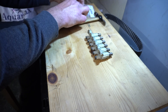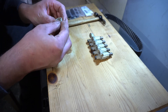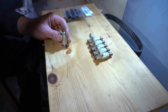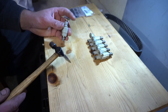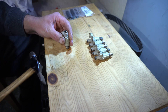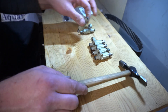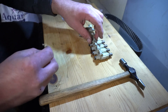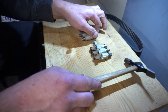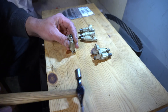The only bit that really takes any thinking about is putting this filter back in. I have a very light hammer here — I'm going to pop the filter in as far as I can, making sure it's dead straight. I'm on wood here and that's quite important. I'm going to put the tip of the injector down and just tap it in real lightly. For goodness' sake, whatever you do, don't do this on a metal surface or anything that can damage the tip of the injector. A nice wooden surface, keep it nice and straight, tap it in until you hear the change in sound — and that's done. A few taps and it's in — nothing heroic, no craziness, nice and gentle. It needs to be flush with the top of the injector.